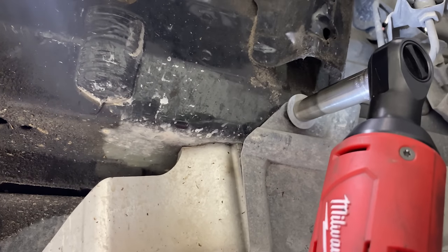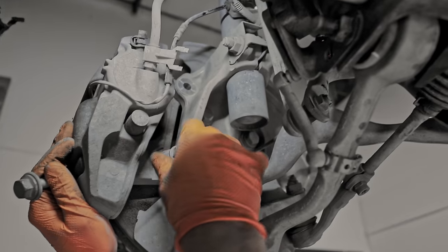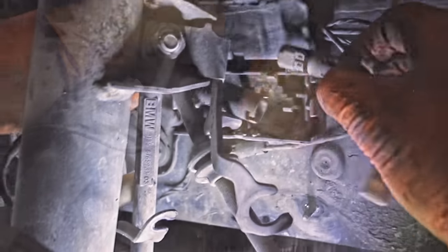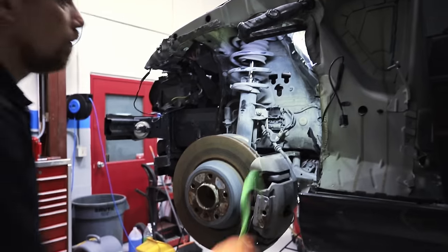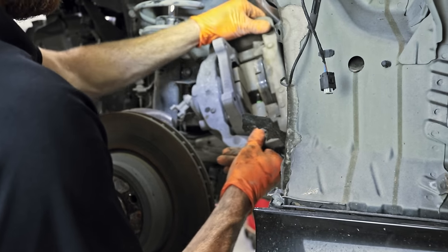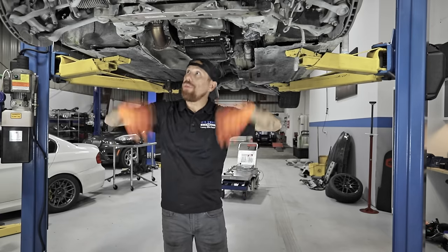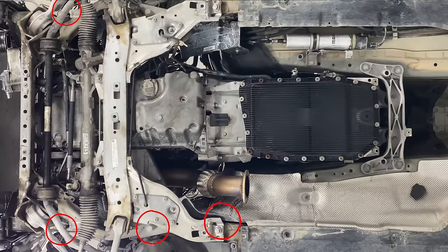This car has tons of plastic all over it, just like any modern car. I have to remove the plastic to get to the bolts of the knuckle, and we're going to hang the calipers. I have this really nifty bendable tool — it's strong enough to hold the caliper out of the way. I'll put a link in the description so you know where to get it. All we have is 10 bolts left and the whole thing is going to come out: six bolts for the subframe and another four bolts for the transmission cross brace, and it should come right out.